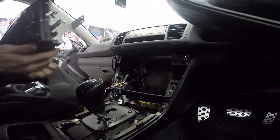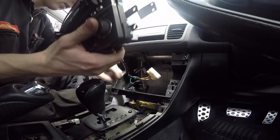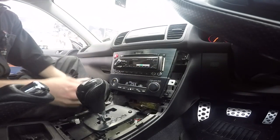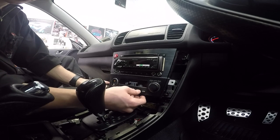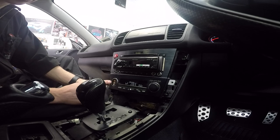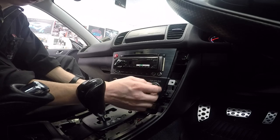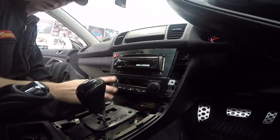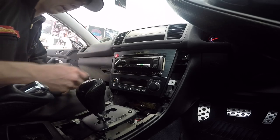What I want to know now is if I plug in this heater, does it go? Plug that in, and also test the hazard light switch. On ignition - yep, the heater seems to work. Fan all the way up, in/out, AC on/off, mode, internal demist, rear demist, auto. Temperature all the way down to 18, all the way up to 32. Dimmer works. Hazard lights work. Cool - all good. We can proceed.